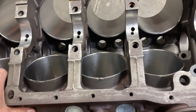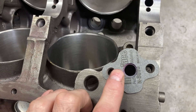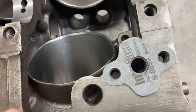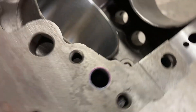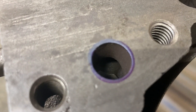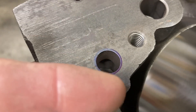As I mentioned in the other video, I still have a restrictor to put in and I'm going to match the hole in the block to the oil pump — gasket match this hole. It doesn't need much; you can see how I've marked it. The biggest issue is that the hole down inside has a very sharp edge — it's almost a 90-degree turn.